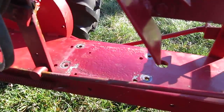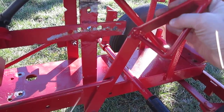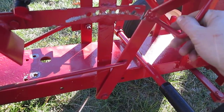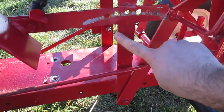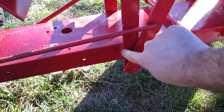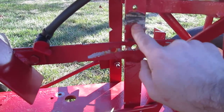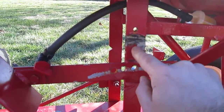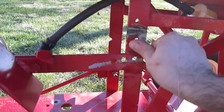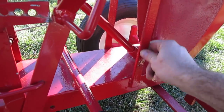There's a little bit of pitting on the frame that'll all get fixed. There's also a homemade speed selector arm — done well, but the wrong proportions and thickness — so that'll have to be taken apart and redone. There are some weird marks and what looks like another hole that'll need welding. Somebody also had an exhaust on it at one time, which is incorrect for an early 55 — it would have just had a stumpy muffler out of the exhaust port — so those holes need to be filled.